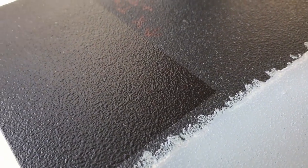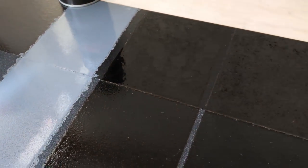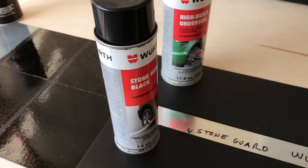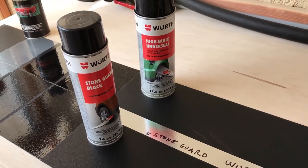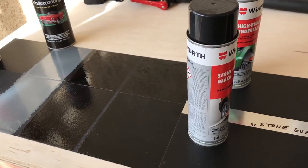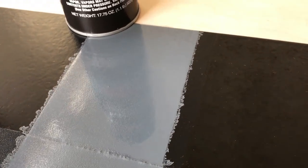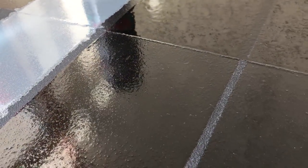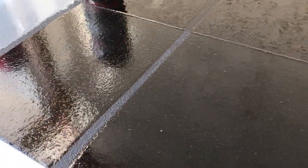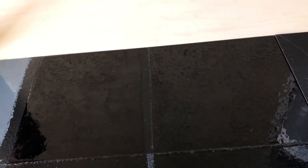So then what I did is I put a urethane top coat on it. That's going to give me the ability to have a washable undercoat. The problem with all these undercoatings straight up is they're not really washable — so once you put it on, the best it's going to look is day one and it's only going to go downhill. I tried some POR15 top coating on some of them and that turned out terrible — it just self-levels and loses the texture.